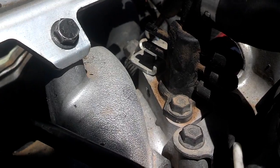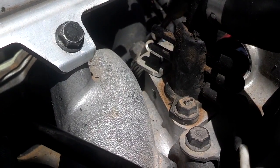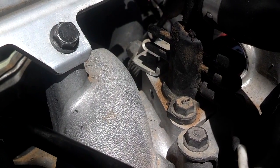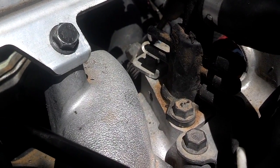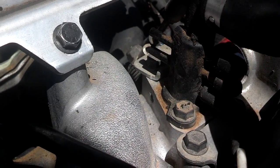As you can see, this vacuum tree is missing two plugs, so I'm going to hook up a silicone hose that loops those two vacuum tree ports closed. Every once in a while you'll get a slight leak at the base of that vacuum tree. It has a gasket, a rubber O-ring in the bottom of it that is a custom fit from Volvo. It's about $1.50.